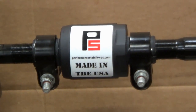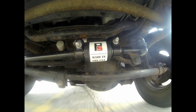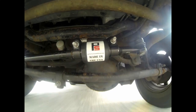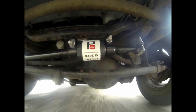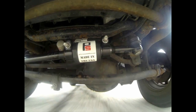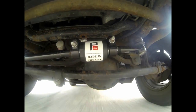This will reduce snap oversteer and also reduce road harshness. We installed an attenuator on our Jeep Wrangler test vehicle and mounted a camera underneath, then took it out on the road. We're doing some lane maneuvers here at approximately 40 miles an hour. If you look up by the right-hand bolt on the attenuator, you can actually see the movements of the attenuator — it's doing its job.